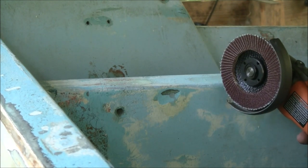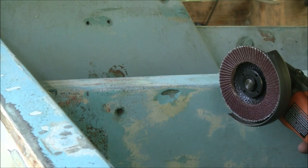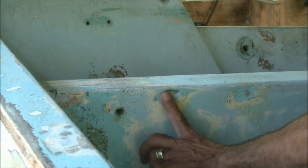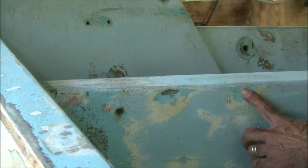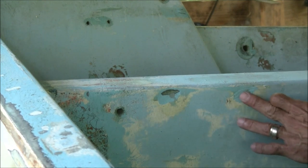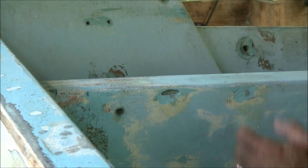You want to go really lightly when you do this. I've got a nice little indentation in there — I'm going to grind out a little bit on this side and the same here. Then go ahead and lay a couple of layers of fiberglass on that, and after that we'll be ready for fairing compound. Before the fairing compound I'm going to go across the whole boat, fix any cracks, get it sanded, then we'll start with the fairing compound.